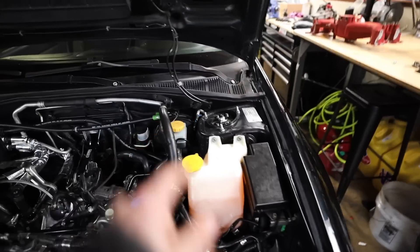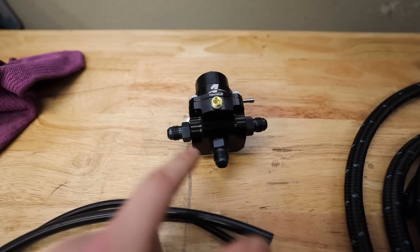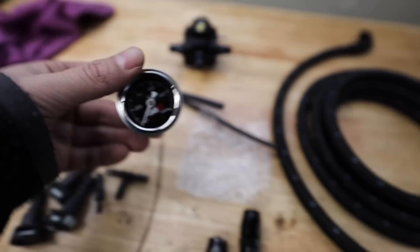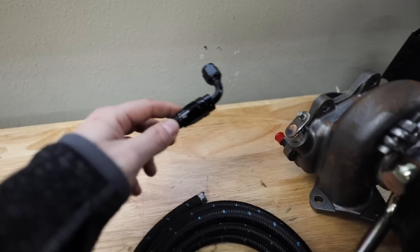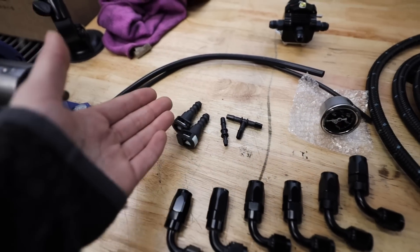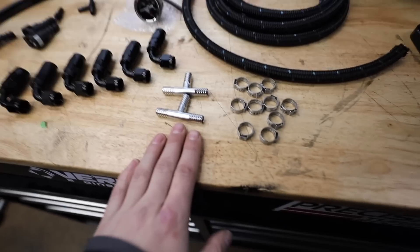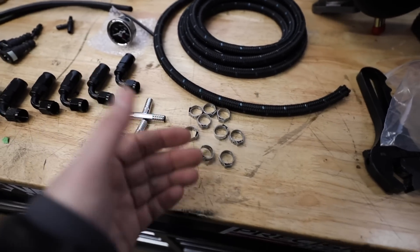We've got fuel rail over here and fuel rail over here. We need to connect those up to the fuel lines up there with our fuel pressure regulator. We have the Aeromotive A1000, and you're going to have to order some Dash 6 ORB fittings if you don't buy the correct kit — if you do buy the correct kit it'll come with everything you need. We have our fuel pressure regulator, three fittings, and a fuel pressure regulator gauge. We have all our fuel line, adapters for the stock fuel rails and firewall, a couple of tee fittings, and some nice hose crimps. I may have to go buy a special tool for those crimps, but we can get everything set up before we crimp them down.